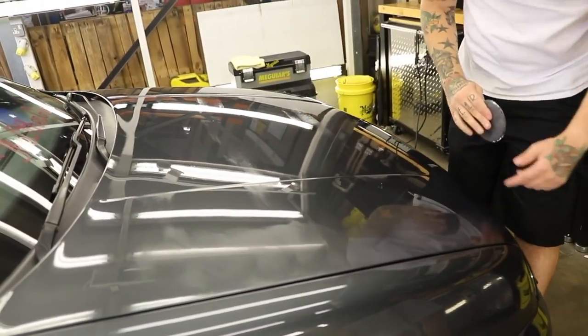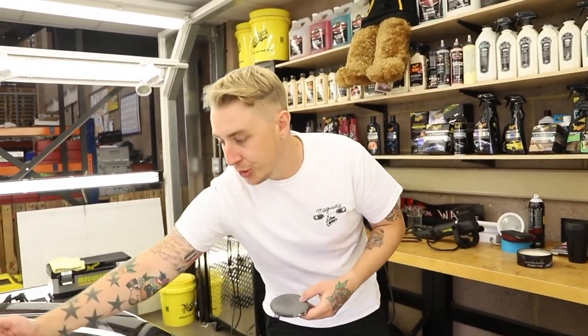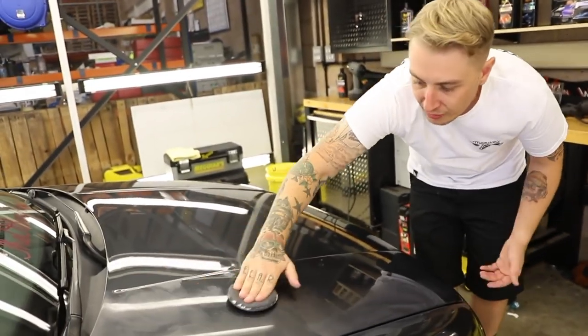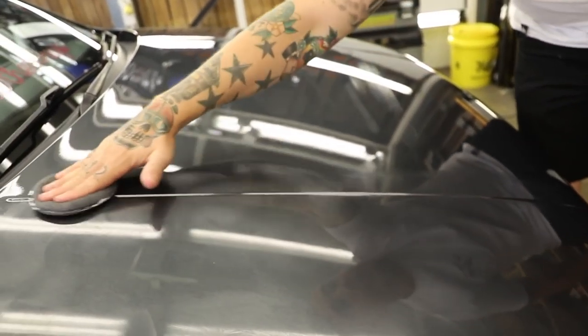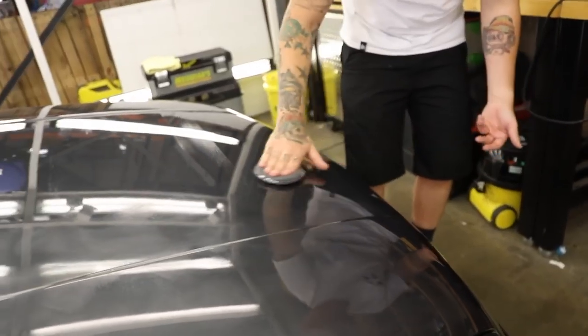Okay. And the reason we put the stripes on there is like we've been doing each time, we wanna prime it. Yeah. So everywhere gets an equal share of wax. It's constantly topping up the pad, yeah? So nice 50-50 overlap, hardly any pressure. Like I say, doesn't matter if you go straight lines, doesn't matter if you go circles, as long as you're spreading it evenly on a nice, clean, prepped surface, you're not going to have issues.